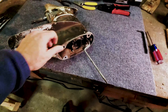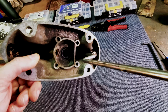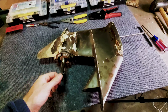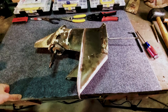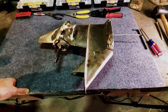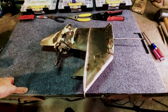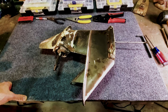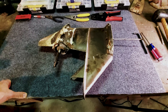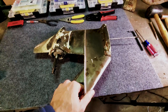I'm a little concerned because where the water pump should be it's a little black in there. It's a very common thing on these old outboards for folks to burn them up, overheat them, destroy the water pump, melt the rubber impeller, etc. I've already turned over the power head and gotten fairly good compression, and I did run it for just a couple of seconds without the lower leg on it but didn't want to risk more than that. It at least appears on the surface to be okay - I'm hoping that continues, otherwise I'll be stripping it down and possibly doing a head gasket.